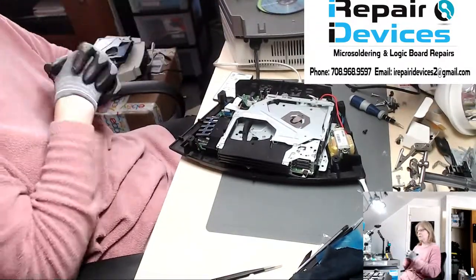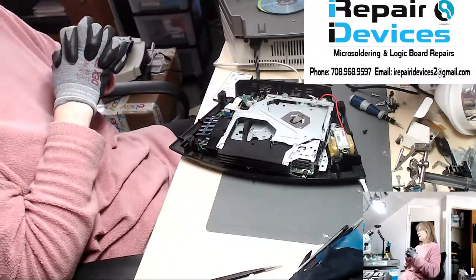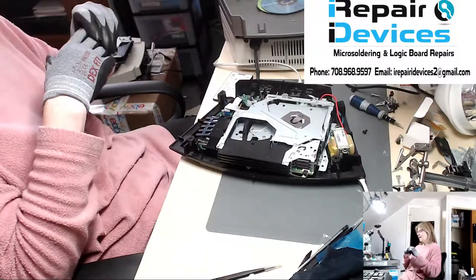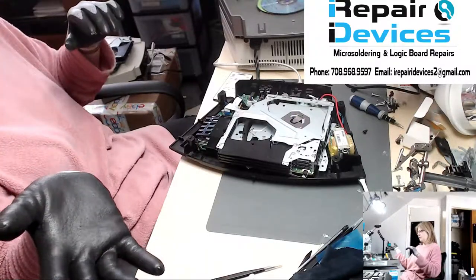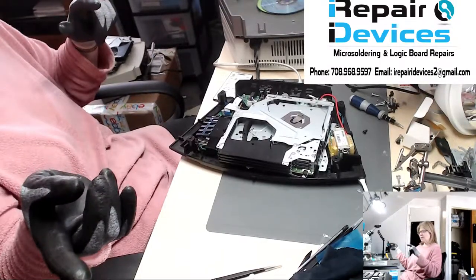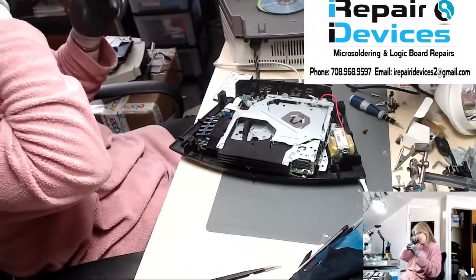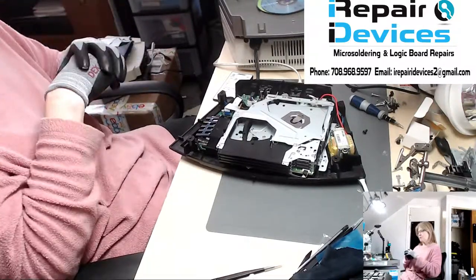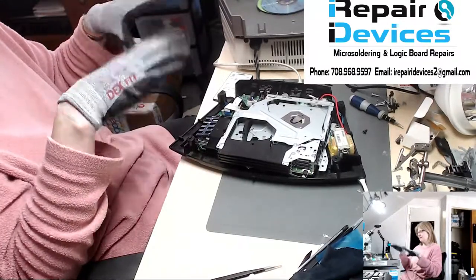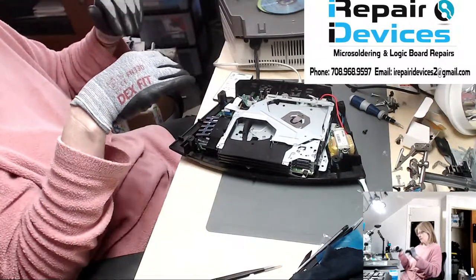And how I solved it was by going to one of the motors and first listening to see where I can find where that clicky noise was coming from. And by applying, well, let's rewind. I hooked up an external power supply and set the voltage to the motors, and then I went through each of the motors to narrow down where I'm hearing that clicking sound. Once I found that, where I narrowed it down, then I was able to focus on where it was coming from, and sure enough found it.